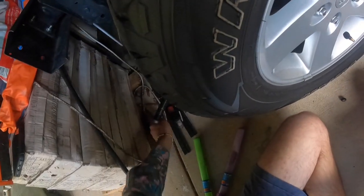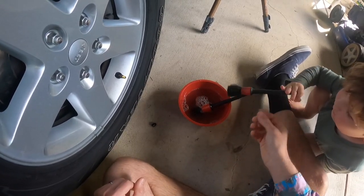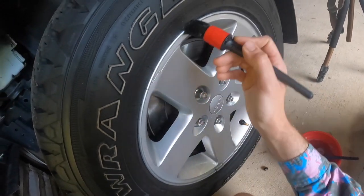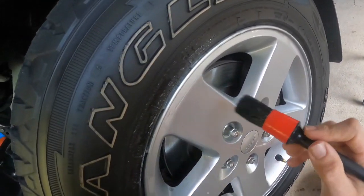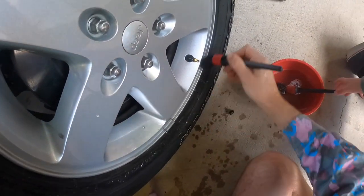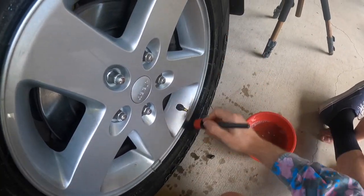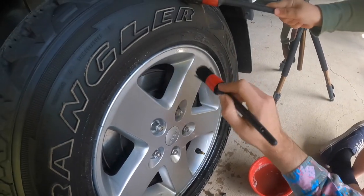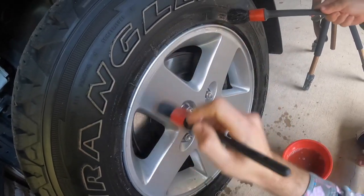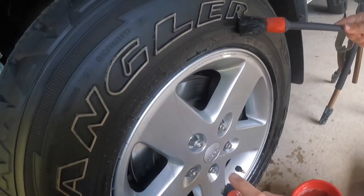Get heaps of soap in there. We've got two brushes here. All we want to do is get our soapy water and paint it onto the tread and around the corner of the tire — do as much as possible. Get a lot in there. Bailey, try and get it into the little crack just where the tire actually meets the wheel, because that's where the air might be coming out from.